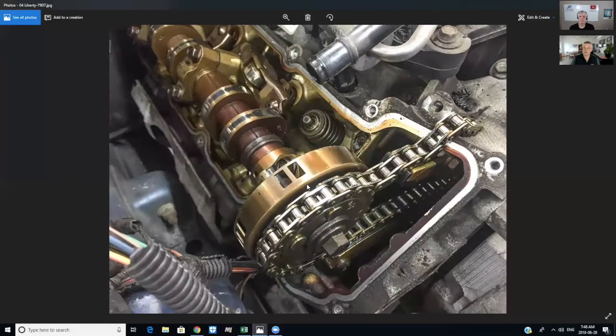Well, yeah. So let's get into looking at a couple of photos here. Here's our engine. This is the right cylinder bank with the valve cover off, and you can actually see the timing. I've actually taken the timing chain piece out. This doesn't normally sit over here. This would be actually inside the engine. There's one piece of it, but this is why it was. The rest of the chain is broken and stuck inside. But you can also see there's supposed to be a rocker arm sitting here. It was actually lying loose. I just placed it here. But this rocker arm had popped off.